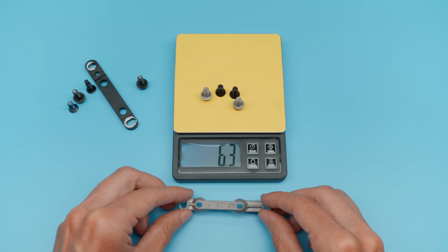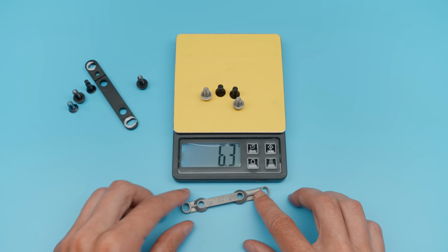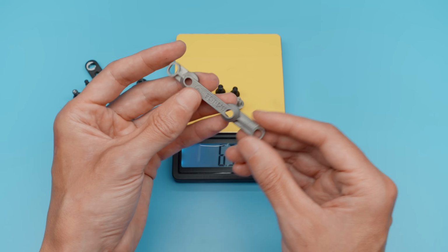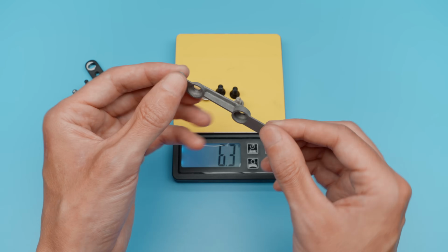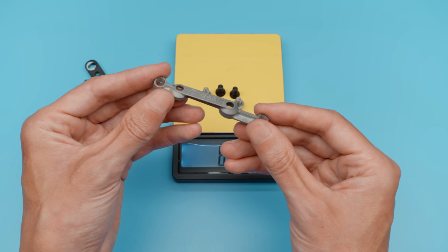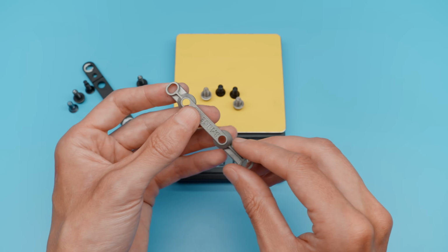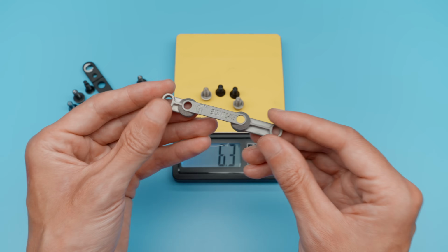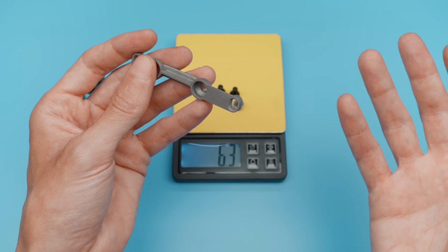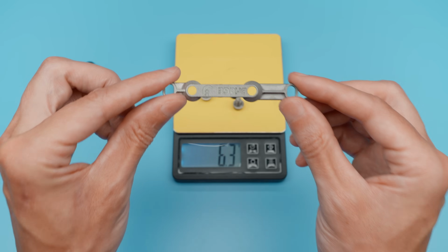As I showed in the original video, I have this little problem that it's not actually flat. So if I push down here, it doesn't sit flat. I thought I would just be able to crank it down on the fork and it should be all good to go, but that wasn't really the case. It was really hard to get this centered over the rotor, and I got a lot of rubbing out on the road as soon as I stood up, which I didn't with the original one. It was not that my fork was not faced correctly or something like that. It's actually down to this thing. It simply doesn't have good enough resolution, or tolerances, to be a good product. So anyway, definitely don't recommend this one.